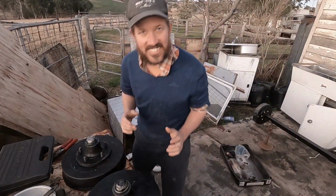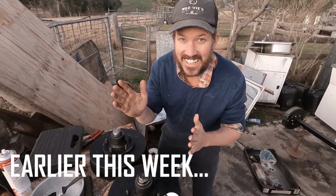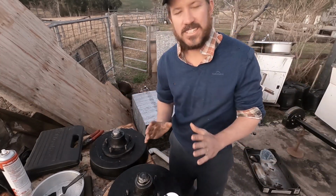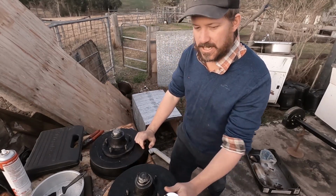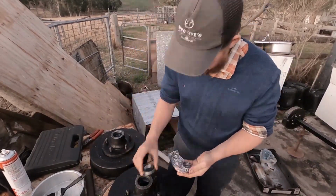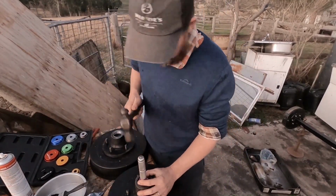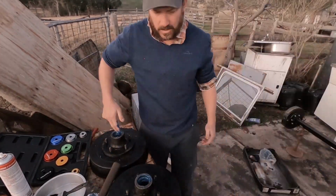Okay, so what we're working on right now is the sun's going down. I'm running out of time. I just got home from work. I want to get these guys back onto the wheel set so everything's sealed up. We're about to have 100 mil of rain in the next few days, so the weatherman's telling me, or lady's telling me. So I'm going to pack the bearings and get these wheels together. Got myself organised. I know where all my bits and pieces are, and I'm going to get this done before it gets too dark, too cold and too wet.